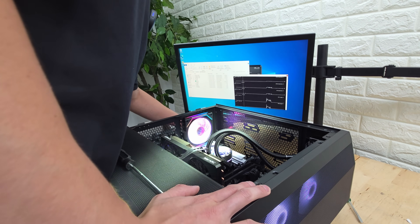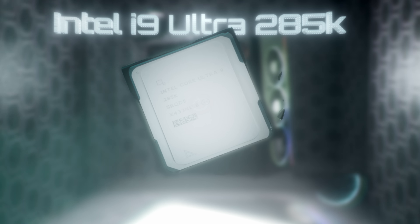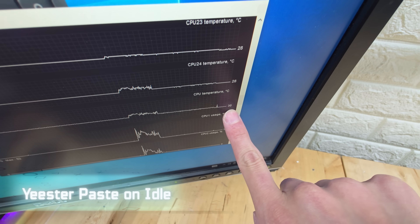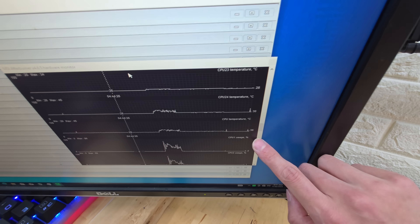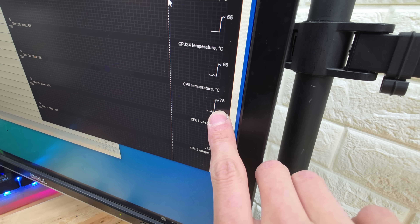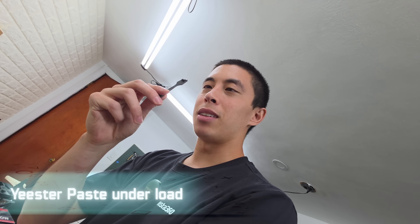So it's time to put it to the test. Our test bench is rocking an Intel Core Ultra 9 285K underneath it. Currently with normal thermal paste applied, CPU temperature while idle is at 30 degrees Celsius. If we run Prime 95, we can see the number jump up — we see a jump to around 75 degrees initially, and it'll settle around 80 degrees. That'll kind of be our reference benchmark for the DIY paste test.